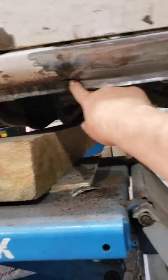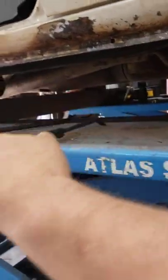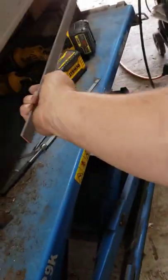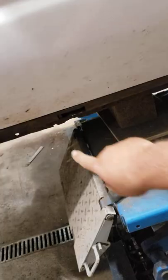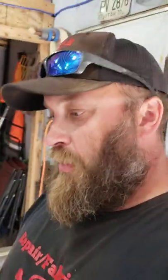There is a hole there because there was supposed to be a hole there for drainage — a little oval — and there are a couple long ones down the edge there. We're plugging away, guys. I wanted to be a lot further than what I am, but that's how things transpire. I need to grab another piece of flat bar to go along the edge there, and then we'll dress that. We got two more spots of rust on the back quarter, then we can finally strip everything, remove the front bumper, and shoot the bottom of this thing with chip coating. Those are our other two spots that we need to fix. We can get that into chip coating for tonight.